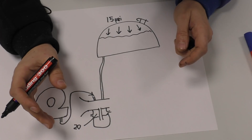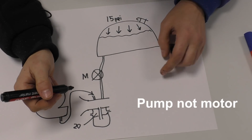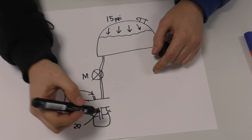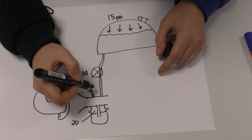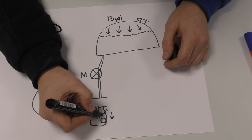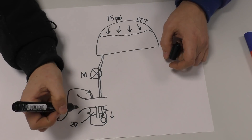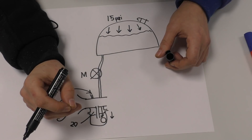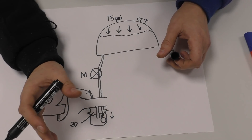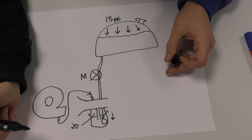The fuel bowl kind of balances out. A lot of people fit a small fuel pump — like on the XJ600, which can have fuel starvation problems. Generally there really shouldn't be a problem: as the fuel level drops, the float drops due to buoyancy, opens the taps, and fuel enters; when fuel gets high enough, buoyancy closes it. What can happen is that higher air pressure can hold that valve open too long, causing funky effects — so fitting a low-volume fuel pump like on the XJ600 is not a bad idea.